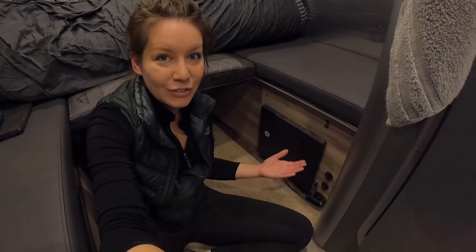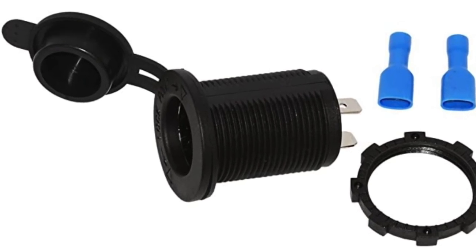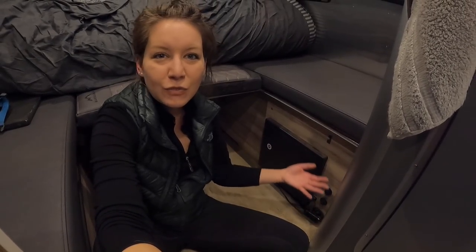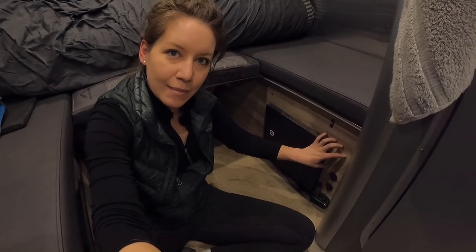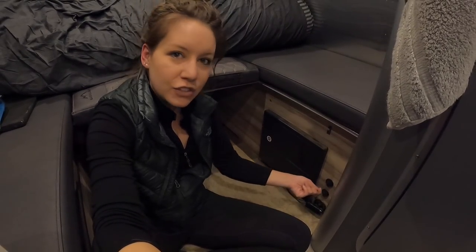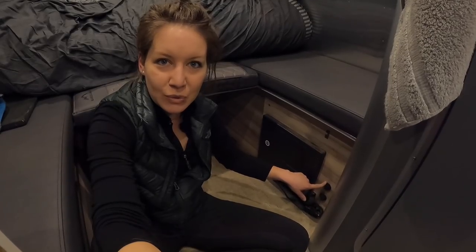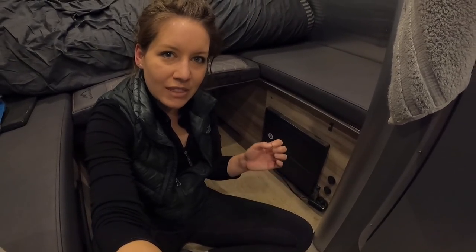So how do you install these 12-volt plugs? It's actually really easy. First, buy the 12-volt plug you'd like — I went with a simple single 12-volt plug and I'll post a link below. There are options with one 12-volt plus additional USBs, or two 12-volts built into one panel — pick the one with the plugs you'll use. Then drill a hole into the cabinet for the 12-volt plug to fit into. I used a hole saw attached to my drill and drilled right into the wood. You do have to be careful to move the Truma hoses out of the way on the inside so you're not drilling into the heat vent. A little bit of sawdust to clean up — not hard at all.